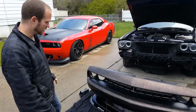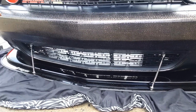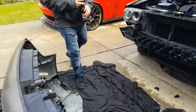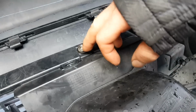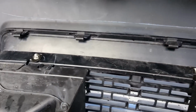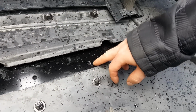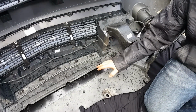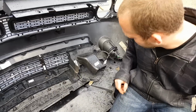See here, we added the splitter rods. They're torqued down on the bottom end and the top end. You can see here, they got the large washer, small washer, and nut, and it's the same thing on both sides. We have all the hardware in place now to get ready to mount it. We had to relocate these because there was a modification prior, but if you don't have any modifications and your belly pan is completely factory, you could use these holes, no issue at all.